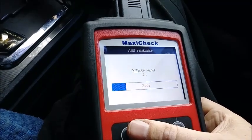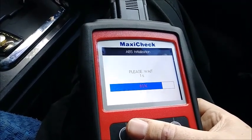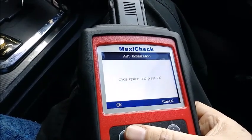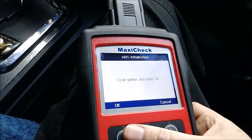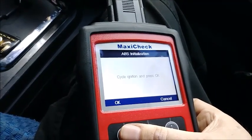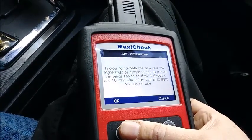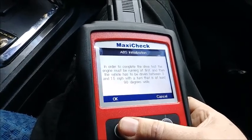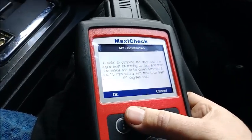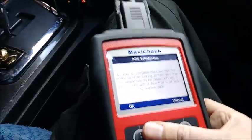Now it's not blinking, now it went out — everything's going. Cycle ignition and then press okay. So turn the ignition off, then turn it back on. It just says cycle it, so turn it on — we'll try just on. In order to complete the drive test, the engine must be running, and then the vehicle has to be driven between 3 and 15 miles per hour with a turn that is at least 90 degrees wide. Okay, start the car. We'll back her out into the street and do that. Me and the viewers will know.